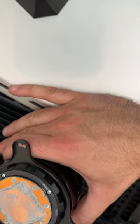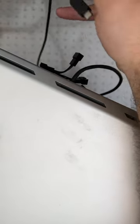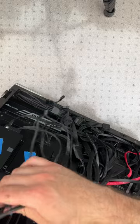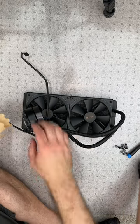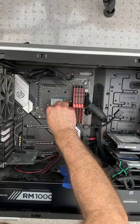And it's time to take out all the wires. This is the USB that connects to the pump, and the other ones go to the fan controller on the case. With my trusty isopropyl alcohol and coffee filters, I'm going to clean off the CPU cooler before I put it away. With the radiator and fans taken apart, I'm going to store all the parts just in case I ever need to use it again. Now it's time to clean off the CPU — I hit it a couple times just to make sure it's completely cleaned off.